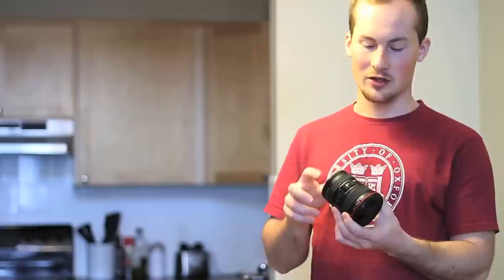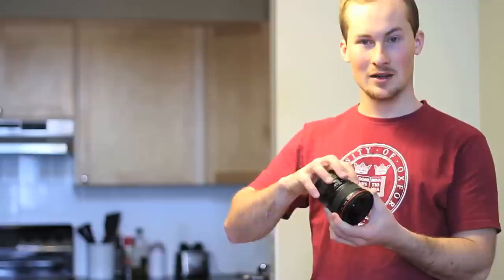Hey, I'm Luke, and if you have had a problem with your Canon 17-40L lens where suddenly the zoom stops working and it's just a loose zoom band and there's nothing going on and you can hear pieces rattling around inside, that's likely because two screws that hold the zoom band to the zooming mechanism inside the lens have fallen off and are now rattling around inside. When this happened to me, I was really worried that my lens was broken and I'd have to pay a lot to fix it, but then I looked online and I found a way you can take apart this lens and it's a fairly simple fix to screw these two screws back on and boom, you have a working Canon 17-40L lens again.